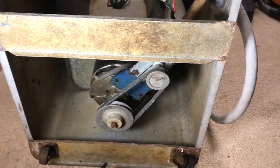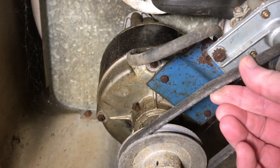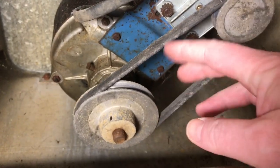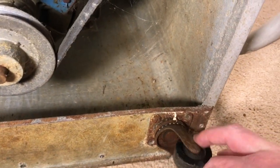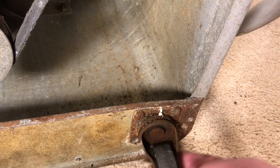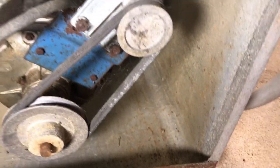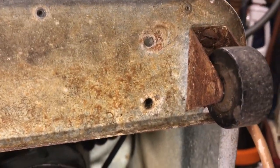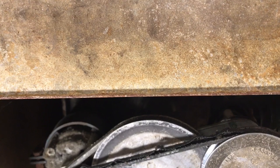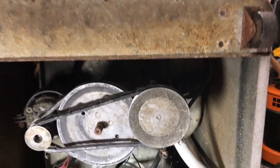I've got it turned on its side. Down at the bottom we have the main motor with the belt — looks a bit perished, but the motor does turn. This needs cleaning up. There are cobwebs inside, and the bearings look like they've seen better days, so it would be a very good idea to replace the wheels. These are bolted in, not riveted, so they can be replaced easily — they still sell wheels like these at B&Q. I'd rub down the underneath and possibly use some Rust-Oleum on there to stop it corroding further.